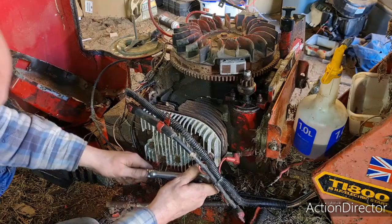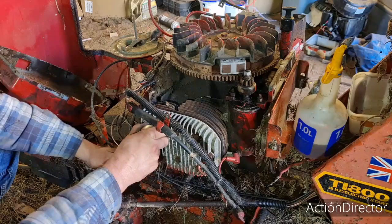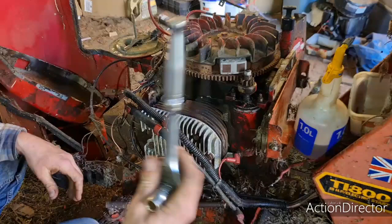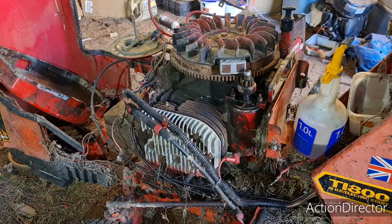That's about 26 foot pound. These are great to tell. I mean, this ratchet is about one foot long, so you just want to put 26 pounds of pressure on the end of it, really. I say, if this was a Formula One car, you'd understand it, but it's a lawnmower. It'll be fine. It'll be absolutely fine.